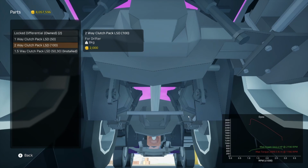So you begin to apply brakes and you downshift the vehicle. When you downshift, the revolutions of the engine climb. You see that on your tachometer. They shoot up, and that inputs torque onto the differential, and it physically tries to slow the differential down, causing the wheels to slow down. So in a two-way limited slip differential, it will allow that limiting action to occur under deceleration as well. If one of these sides were to lose traction, that limiting action under deceleration can also occur. In a one-way, under deceleration, it essentially acts as an open differential again.